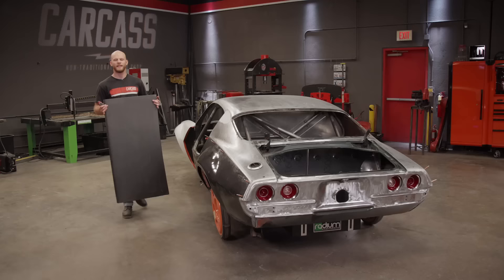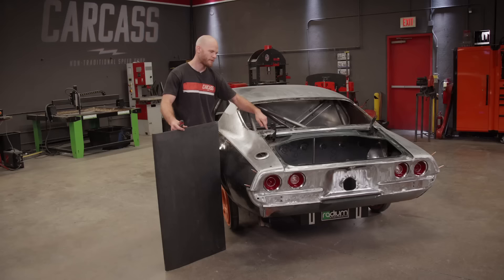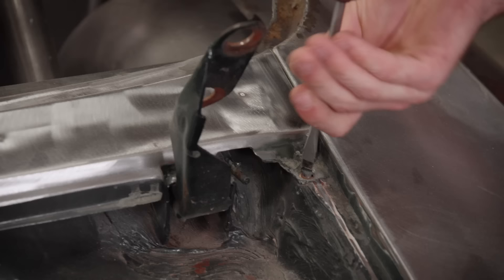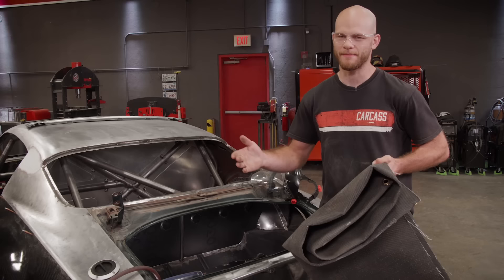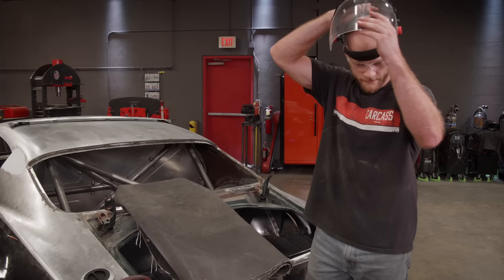Next thing up on the rear end of our Camaro is to get the carbon fiber trunk lid installed. I'm really excited to see this thing in its full carbon trim. But to get it on here, I have to get these hinges to lay all the way flat. They're held up by a torsion bar underneath this cover that runs from one side across to the other. I don't really need these springs to be functional anymore, so the easiest way to get rid of them is to just cut them. They're obviously under a ton of tension, so to keep ourselves safer, I'm going to put something really heavy over the top of them — just a rubber welding mat. I'll cut one of the springs and wear the appropriate PPE.